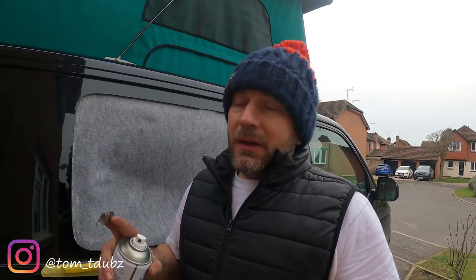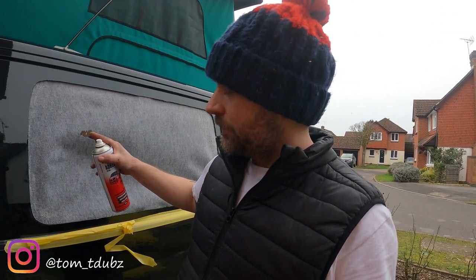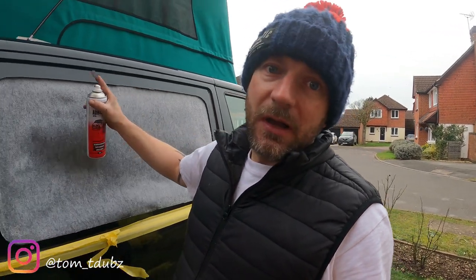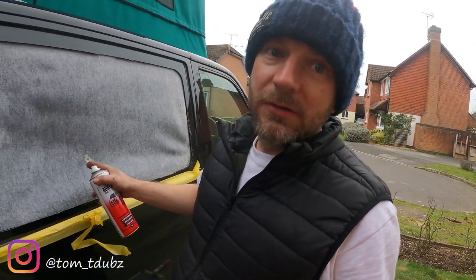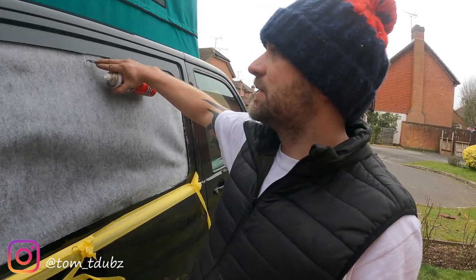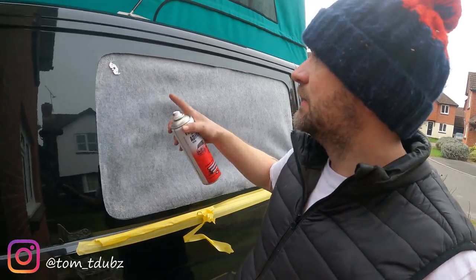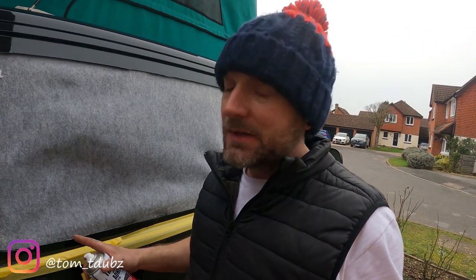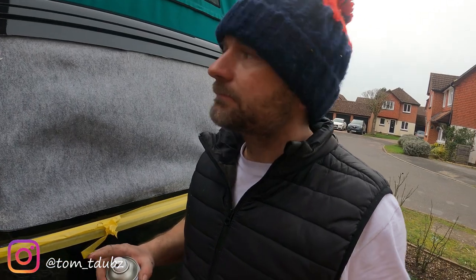This is what I would call a more professional car window carpet lining style. What we're going to do is spray right around the edge about 10–12mm. It doesn't matter if you make a little bit of a mistake because we're going to be cleaning that up before we place the window in. You're going to cut a big X in the window carpet area, trim off the excess leaving yourself a couple of inches all the way around, then knife the edge and peel and stick over the top of the window frame. You get a much better finish — it looks smarter on the inside too.